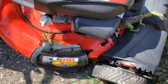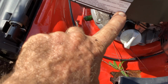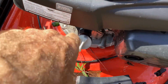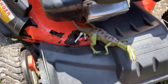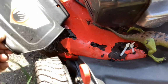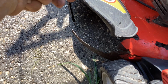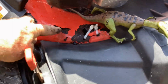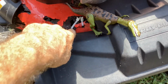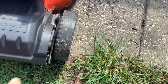Let's move over to this last turd. This happens to be a 2007 according to the EPA emissions control information. That's how I read these Hondas. GCV 160. Oh, lo and behold, we got a little zippy tie action here. Oh, wow. So that's rusted through right there. So deck integrity right away is going to be a concern. Rust throughout here. They took some rust holes and just put some zippy ties through it. And it looks like it's cracked right there.